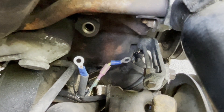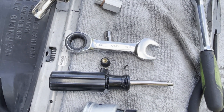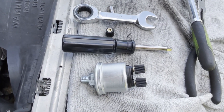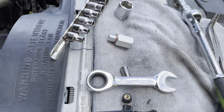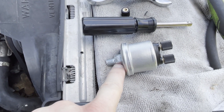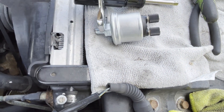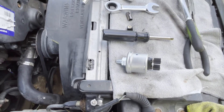The one in the black sheath is the new wire I added, and the one where you can see pink and blue on the terminals is the factory wire. I went ahead and put ring terminals on both to make them nice and snug. I also picked up a set of stubby wrenches to make this job easier since there's not enough room to swing a full-size wrench. I'll use a socket on the spacer first with the copper washer, then hand-tighten the oil pressure sensor, and use the stubby 17 millimeter wrench to finish it off. Let's go ahead and get it installed.